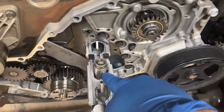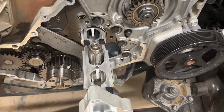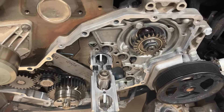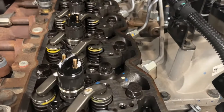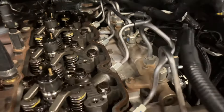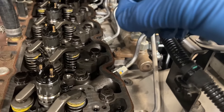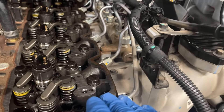After you have all your magnets seated, only then release very slight pressure and carefully lift them up into the bore. When you lift them up, you want a little bit of clearance. I use clips on my magnets — push them down on the magnet stem so you have very little clearance, maybe a millimeter between fully up and where it's held against the clip. This gives enough room to slide in the camshaft.